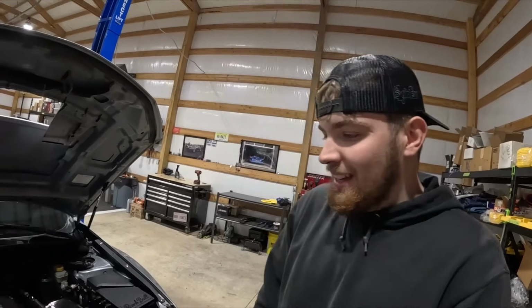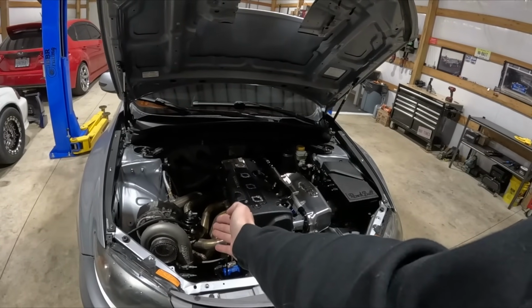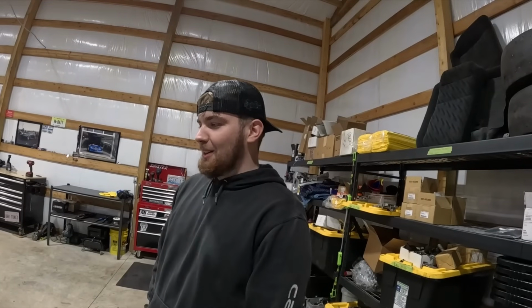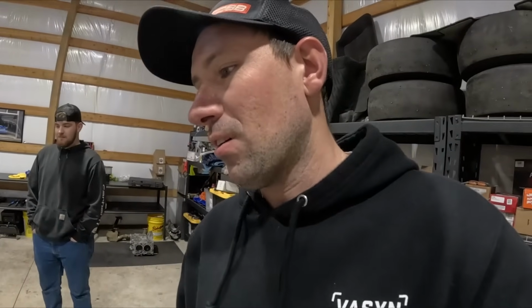So it goes from 8 pounds and then you get to 8,000 RPM and it shows 20 plus. Yeah, I think I saw 25 the other day at like 7,200 RPM. So yeah, that's not ideal, but we're here. We want to get everything dialed in so I can actually rip on it without having to worry about my rod coming through my block. But yeah, we're gonna see what the guy says about his wastegate placement. So it has an 8-pound spring in it today. We're gonna just focus on getting a nice clean power band, get him to enjoy the scene. I may have to cut the RPM short just because of boost control, which he already knows about.